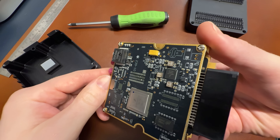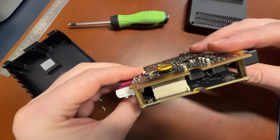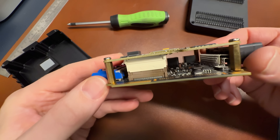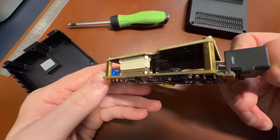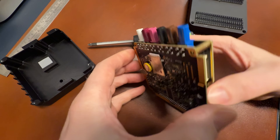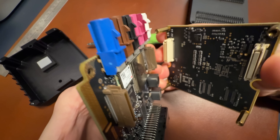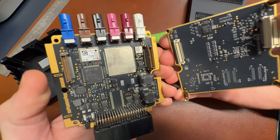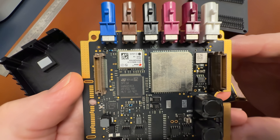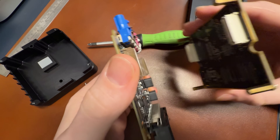There's a little heat sink there which supports the chip on the back. That rear chip is actually an IMX6, which from memory runs mainly a Linux-based system for communication. But a lot of the display stuff in the Arrival van is actually running some sort of Android-based display system. Hidden inside here is then an STM32 family, which is a very commonly used microcontroller chip. A couple of other bits, and then the one with the white sticker is actually what does the communication with the SIM card and deals with all of that comms.